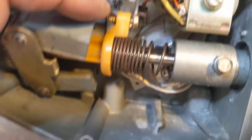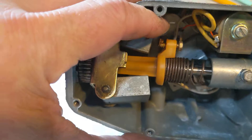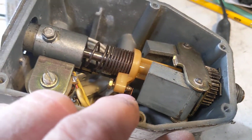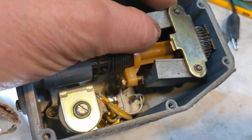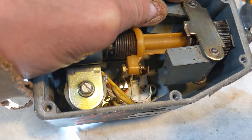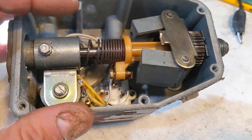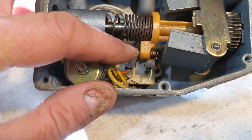As it goes out, when it achieves about 30 miles an hour, this is an adjustable switch for the low-speed cutoff. There are two copper strips — they're called points. As this goes faster, it lets go. When it lets go, those two connections connect; when it pushes, it disconnects. So that disconnects and disables the unit from holding speed — it will not hold speed below approximately 30, apparently adjustable by this screw.